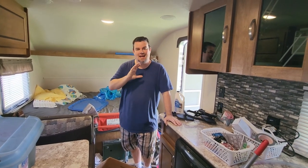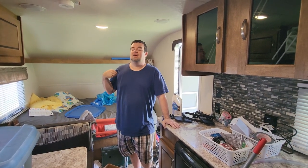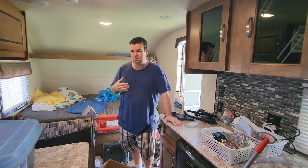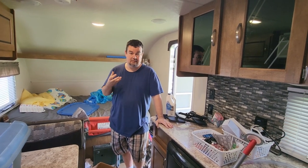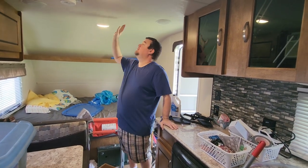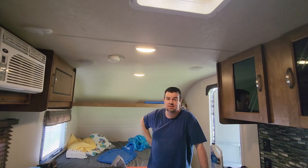But before you get into any of that, the first thing you should do when you walk into this is take a deep breath. If you've had leaks over the course of the winter and you've got issues with leaks, especially in a camper like this with wood frame construction, you're going to smell something pretty quickly to indicate that there's a musty odor, to indicate that you've had water ingress. It's a very good idea, of course, to look at the ceiling, look at the Luan board in the ceiling to look for any bubbling, any warping, any obvious signs that water has got in.